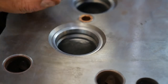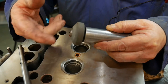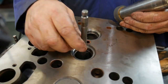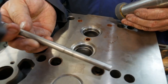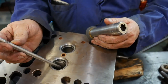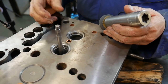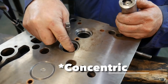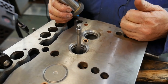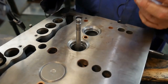That's the right size. So now I will install that on one of our driver mandrels — they just thread on and you want to just snug them up. You don't have to make them tight because it's going to turn in a tightening rotation anyway. Then we put our guide mandrel in there. This happens to be an expandable mandrel — the right one for this head. If I put that into the guide and snug this, it expands the other end to make it tight so there's no wiggle or movement. Now it is perfectly symmetrical with the seat, so when I grind the seat, the seat is going to be symmetrical with the valve stem.